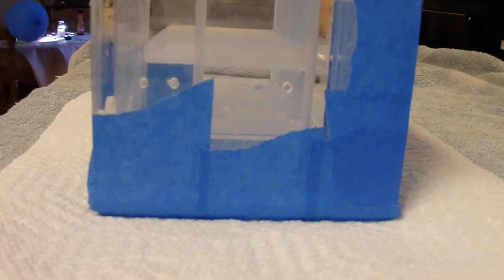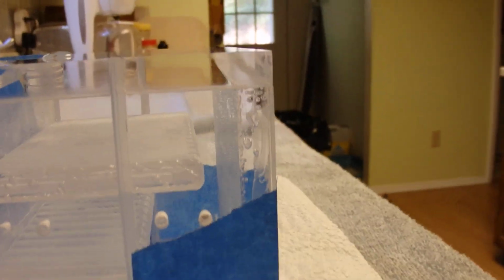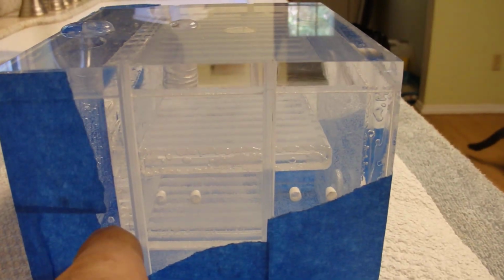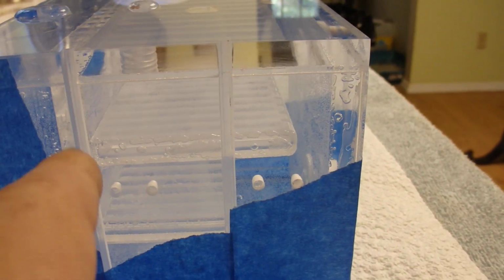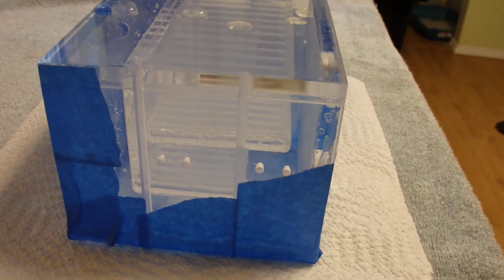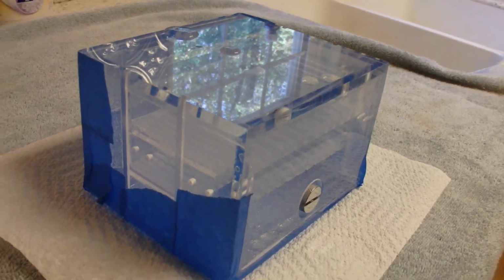here. You can kind of see from the side, I made some slight changes to this reservoir from Poofy Minion's reservoir, partly because I want Poofies to be unique, and partly because, as one commenter pointed out, there was a little ledge here. I had a 1/4 inch ledge here just for looks, and that could potentially trap a little pocket of air underneath it, which is easy enough to get rid of by tilting your case around when you're first running your loop.